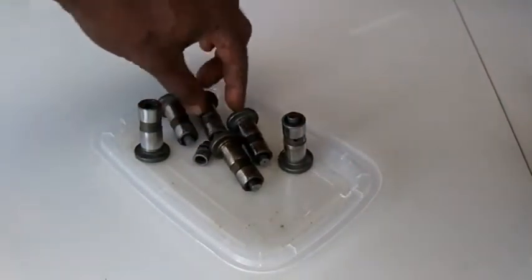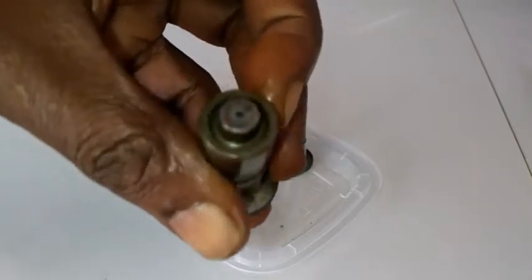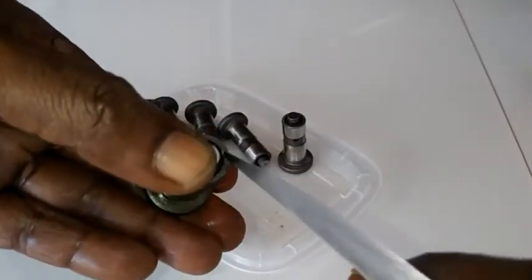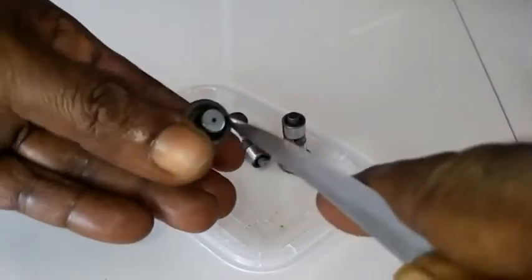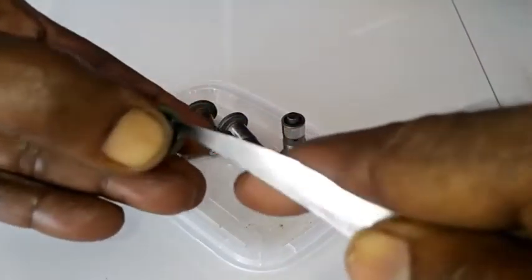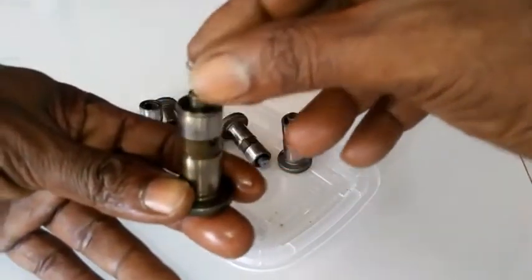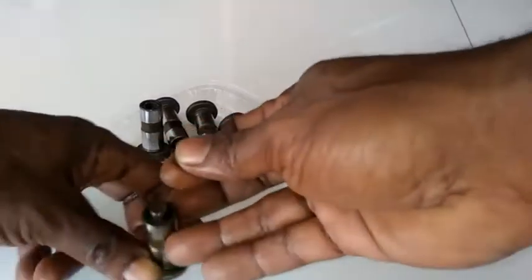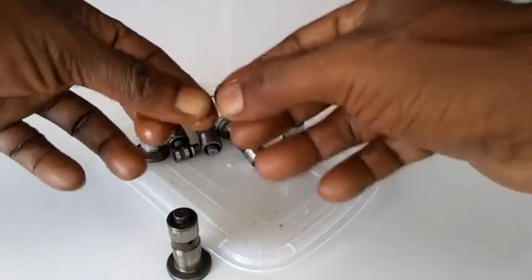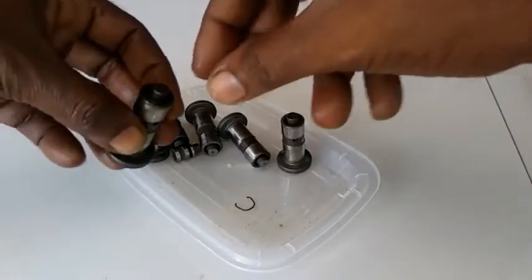What I'm going to do is take apart one that I've already taken apart — that's this one here. You can see that retainer, that C-clip, that wire clip. You want to take your thumb and just place it on top of the lifter. Using your tool, a pick, just pop this spring out of its channel. When this spring is released, if you don't have your thumb on top of this lifter, you could lose this retainer clip, and you will not be able to substitute anything else for it because it's hardened steel. You can't just put a wire in there, so it's very important that you remove it the way I showed you.